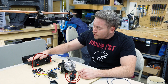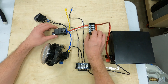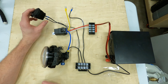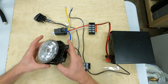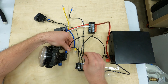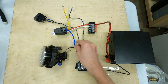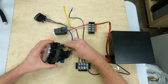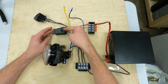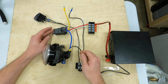Let me give you a better idea of how a relay system works. This power supply is going to be acting as our battery — you've got a power cable and a ground. The power is being distributed at this block here just for the sake of this demonstration. We have our relay with five wires out, an example accessory device — in this case my old fog light — and a switch. Now let's simplify things: remove the switch, remove the relay, and say we just wanted to power the light directly. We can do that by jumpering it straight to the battery. But we're not going to want to connect these lights directly to the battery; we're going to want to insert a switch, and that's where the relay comes in. The relay is really just a switch — power comes from the battery through the red wire to the switch, and when the switch is closed or activated, power comes through the blue wire to the accessory, which is then grounded back to either the chassis or the battery.